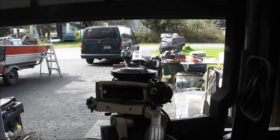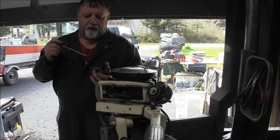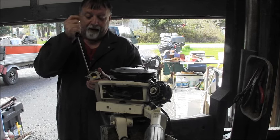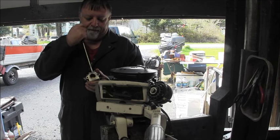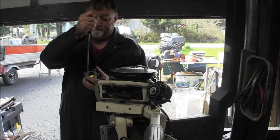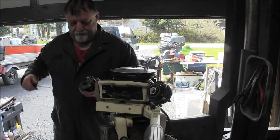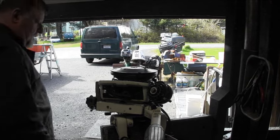You can see there's a little rust in some of them holes. I'm just going to spray it real quick with some canned carb cleaner and some compressed air. When you're tightening these plastic tops back down, there's a number sequence you're supposed to go in — it's written right in the plastic itself. The main thing is you don't want to use your driver to do this. You want to use a screwdriver and do it yourself real gently, because they will crack. A lot of times people go to clean their carburetor and over-reef on them. That's what causes the crack. Real gentle — just snug.